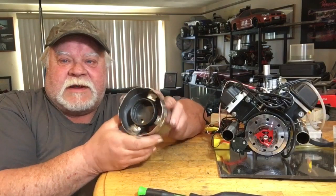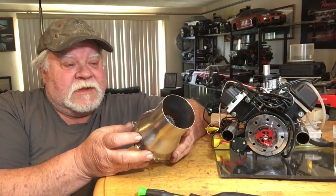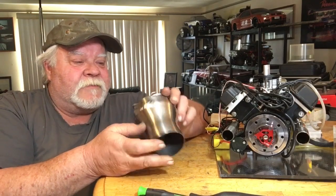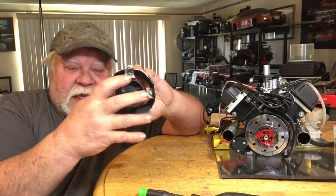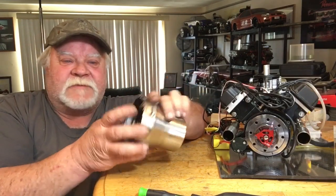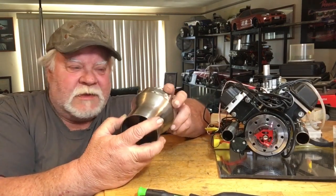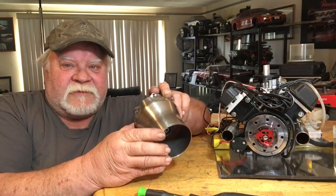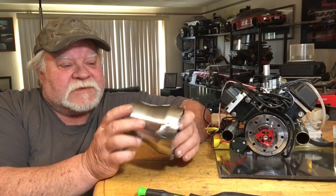Now I'm trying to come up with a gearbox setup here. I know it looks crude — what it is is a piece of hardened stainless reduction pipe for a diesel, going from four-inch to three-inch. I had to center one of our clutches in here, make little tabs, and weld them in just to try it out and see if it's going to work, because when the clutch grabs it wants to twist the housing. I used hardened stainless tubing specifically so it wouldn't flex.